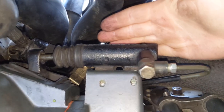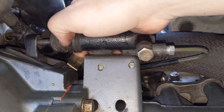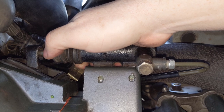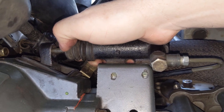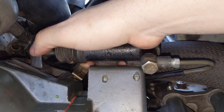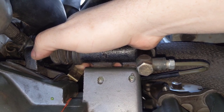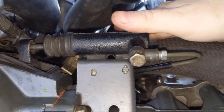So what's the trick? It's actually quite simple. Do the same process, but once you tighten that nipple and you're holding this lever in, release it slowly. Watch my thumb — like that, slowly. So imagine I've got that pulled in. I'm going to pull in with the nipple open and squeeze the air out, then close the nipple with my other hand. And then, when the nipple's closed, just slowly let that piston move back out. Do that a few times and there'll be no air left.